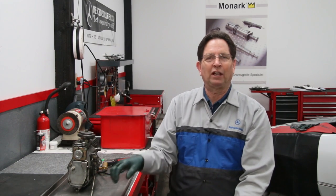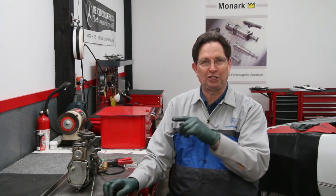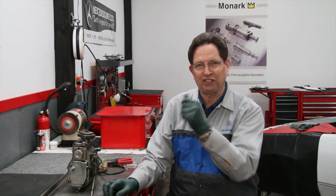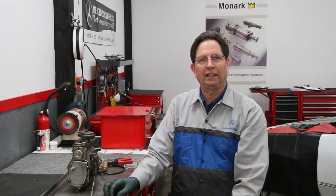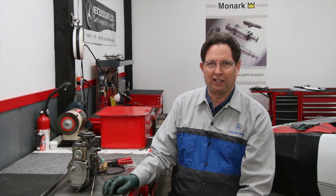It's a common problem as these old Mercedes diesels age. The fuel shutoff system just kind of fails, and when it does, the only way to shut your engine off is to push on that emergency lever on the valve cover. Make sure that works — just try it sometime with the engine running, because it's very embarrassing to not be able to shut off your diesel. Some people with manual transmissions have resorted to putting it in gear and popping the clutch to try to get the engine to stall. I would not advise that.